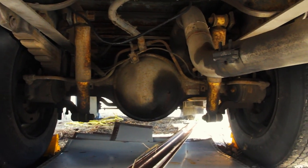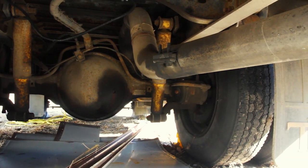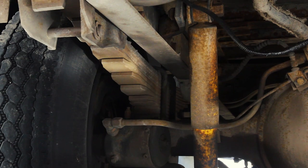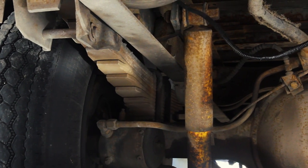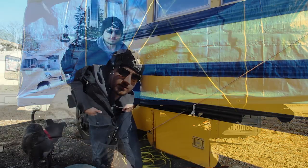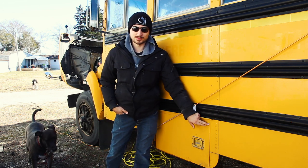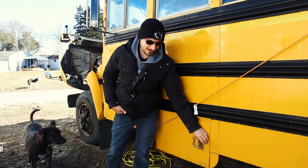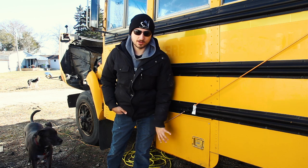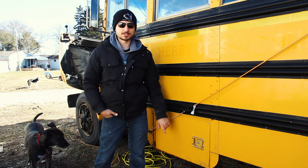You can also see the struts and leaf springs at the rear — check those the same way as the fronts. Check the rear of the braking system for hydraulic fluid leaks as well. You get a better view of the inner duallies from back here too. Also check body panels — some may be latched incorrectly. Make sure all panels, including battery panels, storage compartments, and any other panels, are all properly closed.